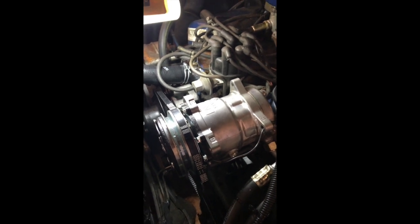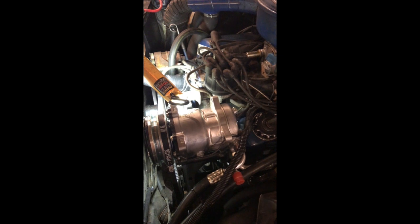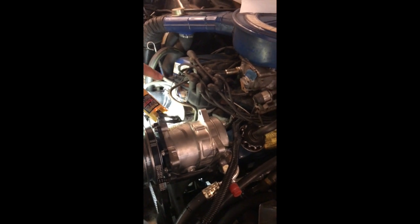Here's an important thing about ignition timing with any internal combustion engine running an automobile: the camshaft turns at one half the RPM of the crankshaft. That's because it's a four-stroke engine — every other upstroke of the piston is either compression or exhaust, and every downstroke is either the power stroke or intake. We need to make sure that when we set our timing, the distributor cap rotor is pointed to the ignition wire that goes to cylinder number one, so we know it will fire on its compression stroke.